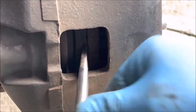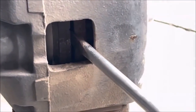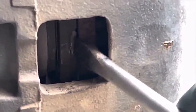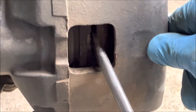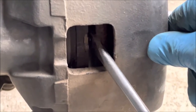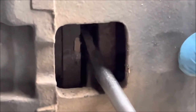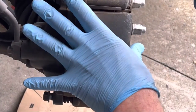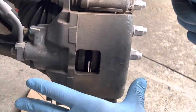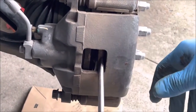Now I'm going to get my screwdriver in here — I've got it. She's loose there now; she's going to push that piston right back up into the caliper, and that's what you want. Push her back until she bottoms out and just stops — that's just about it. The caliper goes right back on with no problem. If you don't do that, you're going to think the pads are too big, but they're not — you've got to push that piston back first.